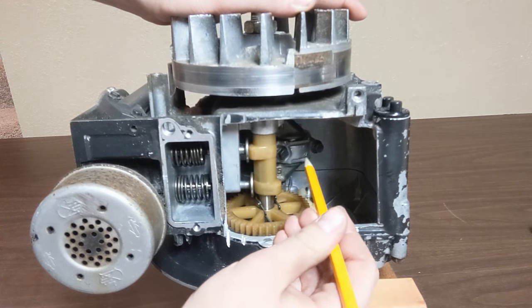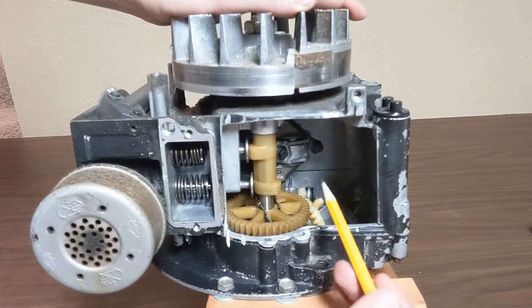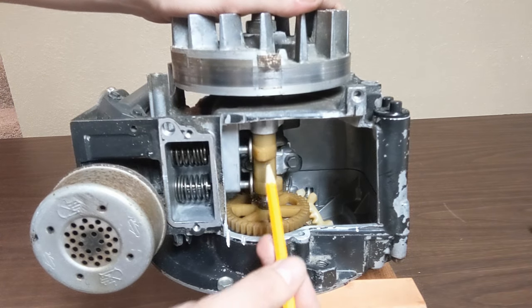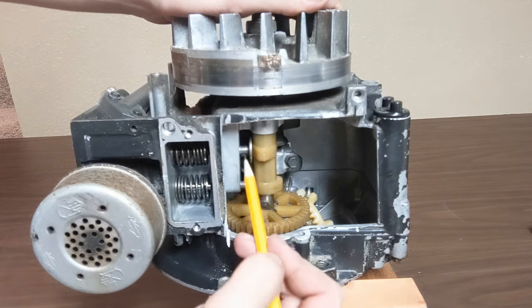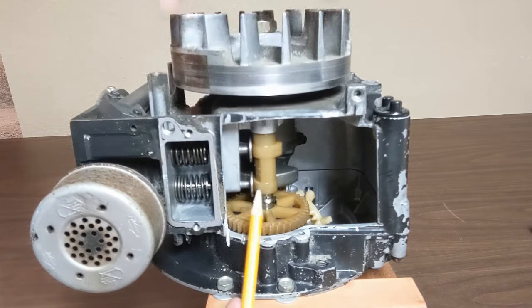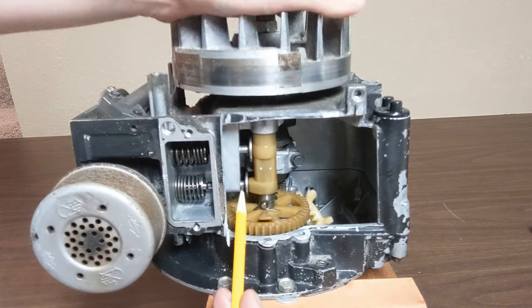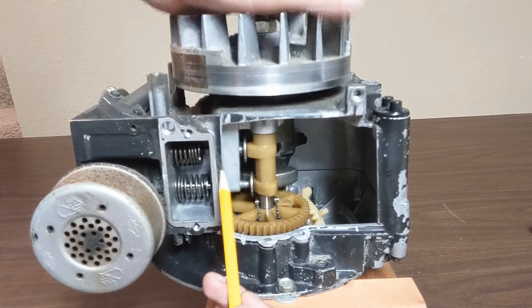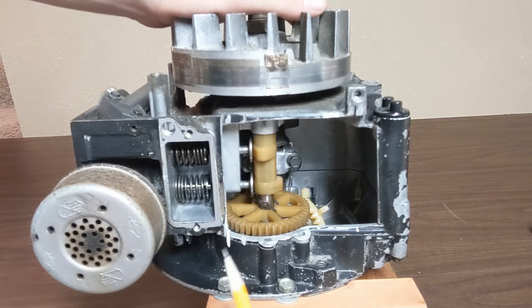Right here is the connecting rod, and that connects the crankshaft to the piston making it move back and forth. Next we have the camshaft, and this is what operates the valves. It has two cam lobes on it, which are basically egg-shaped lobes that bump each of the tappets at the right time to open the valves. As you can see, the lower lobe is tapping the exhaust valve opening that valve, and then we'll see the intake valve up here be opened. These are the tappets and they are what push the valve stems, which in turn open the valves inside.